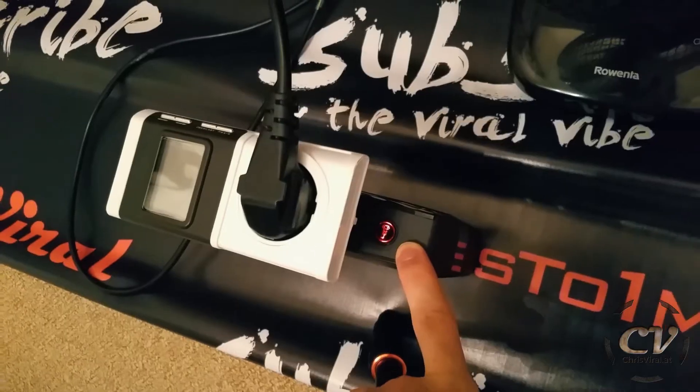It's almost one o'clock a.m., it's flashing red. It is already Thursday, and I just now analyzed the time-lapse — here are my conclusions. The fan needs around 25 watts. Up to around 20 minutes, the power bank delivered 25 watts, which equals 8.3 watt-hours. At 20 minutes it dropped down to 20 watts, and the Halo Bolt sustained 20 watts for two hours straight, which equals another 40 watt-hours. About two minutes later it dropped from 20 to 18 watts.